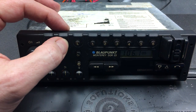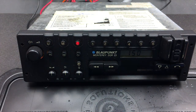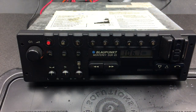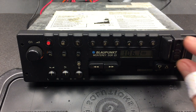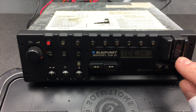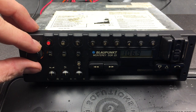What we can do is click the M button and get medium wave — you can see it on the display — and the L for long wave display. I'm going to head back to FM. Now there are a couple of tuning modes with these two rocker switches: sensitivity low, high, or manual. Right now I've got this on low sensitivity so we can click and it will just scan. With regular sensitivity it's going to go and find a channel.